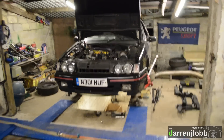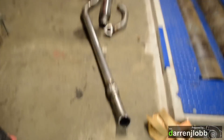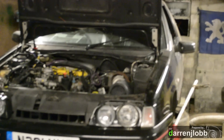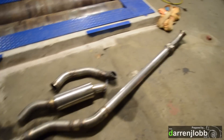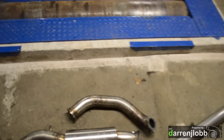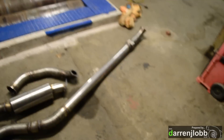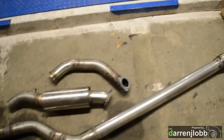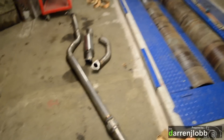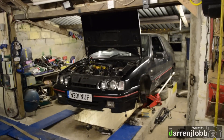Everyone's gone home. This is the sort of semi-war zone that's been left. We've had Tom and Ruin here today and we've got Tom's ZX back down again. It's a little bit tricky because the turbo on this one is obviously relocated in the battery area, and that was only two and a half inch pipe up to that point. So I've had to go all the way from the back of the turbo — we've got a made-up downpipe which is the bit in the front there. Put a V-band on that so you can easily disconnect it. Then the centre section with a short flexi in the front for a bit of give, and a back box with a straight-through box in it. That will hopefully get bolted up tomorrow and we'll be doing some dyno runs. We've already done three passes today.